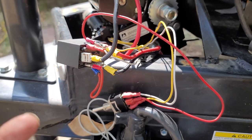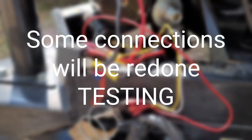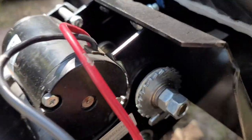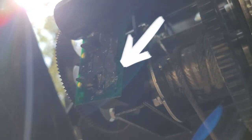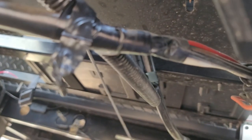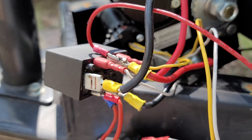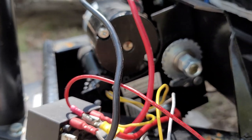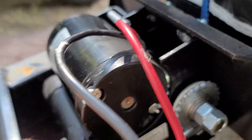Okay guys, we have a mess here, or at least it looks like a mess. I haven't got it all tied together in place yet. On these electric winches on pop-ups, there's the original solenoid. I was still able to go down but I wasn't able to go up. I just pulled all the wires off of it and I'm going to leave that up in there, because if I have any issues with what I did here I can plug everything back into the original one and still be able to make it go up and down. Coming down was no problem; going up I had to tap on the relay to get it to work. Anyway, I bought this one I found on Amazon.